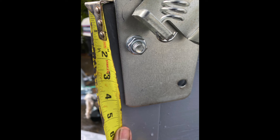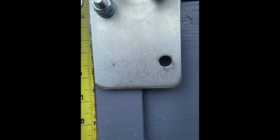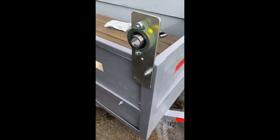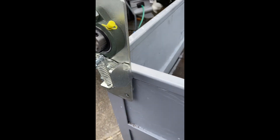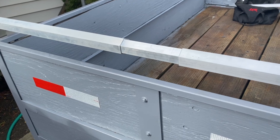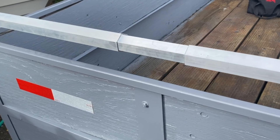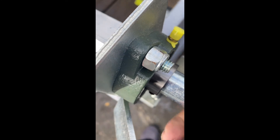First step: we take the measurements of the height and width of the brackets, then replicate that on the passenger side. We drill a hole and put in the first bolt. The issue I have is my utility trailer doesn't have wide structural support that a dump truck or heavy-duty trailer would have, so to put in the second bolt we'll have to drill it later. After that, we cut the outer channels and inner channels with the grinder to make it fit. I had an issue using self-tappers because it was spinning on the bearings, so then we install the gear.